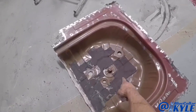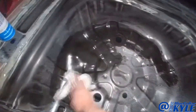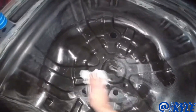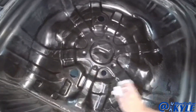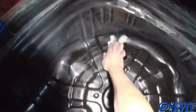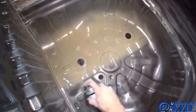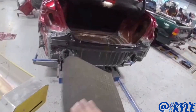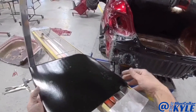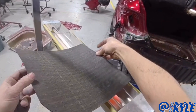You can see here this old floor has sound deadening pads that go on the bottom center of it. So I'm going to clean off this new trunk floor and put some paint down in this bottom section so I can lay out the sound deadening pads and get that part finished up, then whenever our paint department paints this trunk floor they can just spray right over all of it. These are just some generic sound deadening pads — I use this heat lamp to warm them up, make them more pliable, and it also makes them stick a lot better.